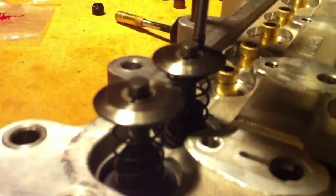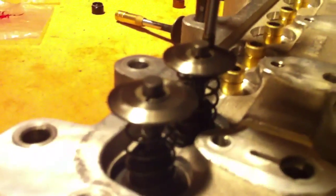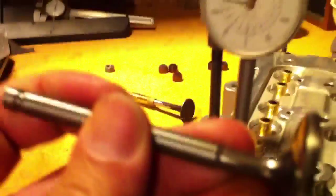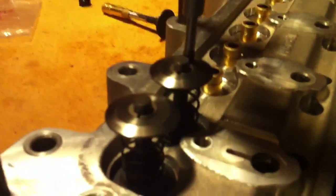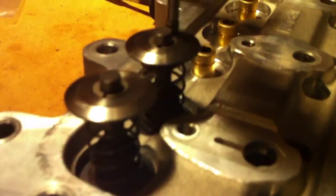This is the same trick I used on my own cylinder head — not quite this cam, but still nearly half inch lift — and that's been working for years. Here the numbers just didn't add up right. We tried to find the longest valves; these are the Rimflow valves, very expensive raised valves. They measure about 3.6 inches, the spec is 3.57. If you measure carefully from the flat below the raised rim, they are at 3.57, which is the specification for the longer valves used later on. The Cooper S had 3.53 valves, which was a weakness of the cylinder head that tended to crack. The later heads all used the 3.57.